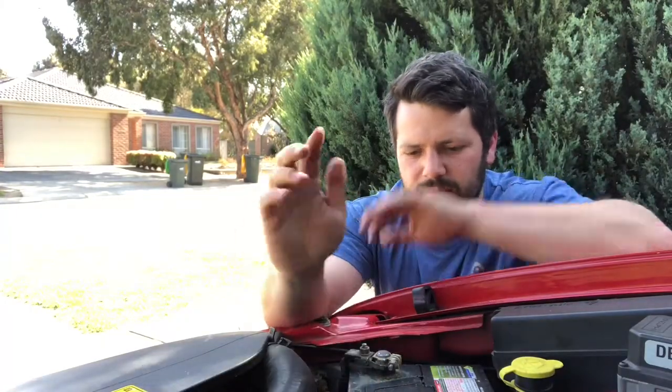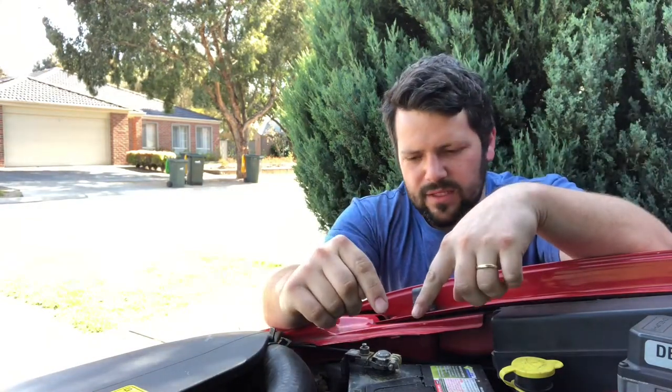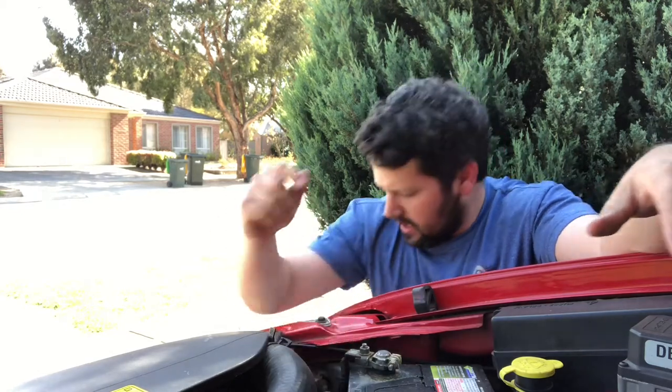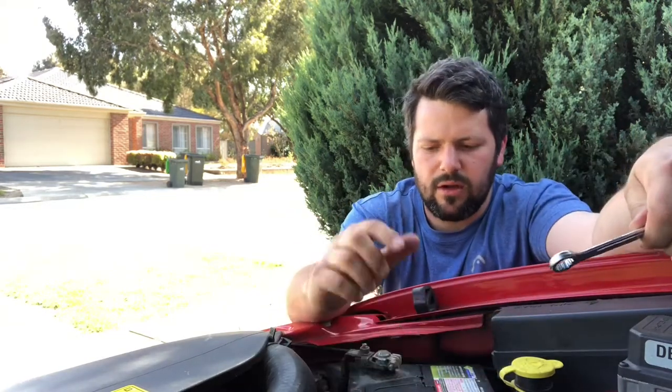First I've got to scan the battery from my car and then we'll grab the other one. We'll get this off first. Basically all it's holding it in is just a screw here and that one will be 13mm. That locks on straight there, basically holding the whole battery down. Then we'll disconnect the battery. I'll speed this up a little to make it less time-consuming.